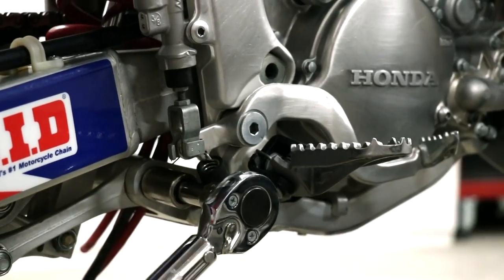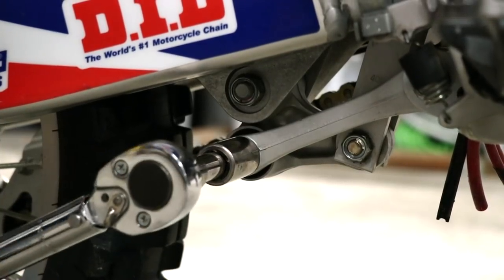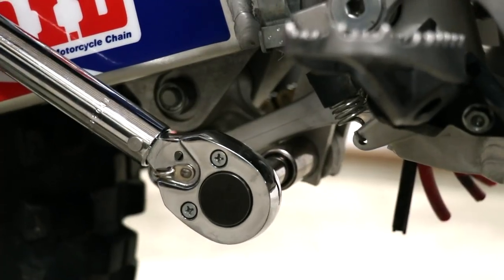The order in which you torque the bolts doesn't really matter a whole lot, but it makes sense to torque the frame and swing arm bolts first, then move on to the connecting bolt, then the shock bolt. On this particular bike, an 05 CR125, the torque spec is 39 foot-pounds for all the bolts except for the lower shock bolt, which should be torqued to 32 foot-pounds. Now you have no excuse to go grease up your linkage bearings. Try to do this every 10 to 15 hours of ride time, maybe even sooner if you're riding in sand or muddy conditions. And you should have no problem pressure washing around the linkage, just as long as you don't get within an inch of the seals. All right guys, thanks for watching and take it easy.